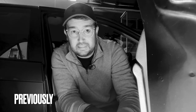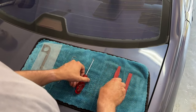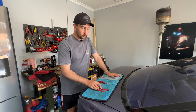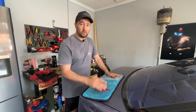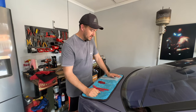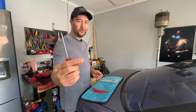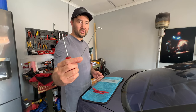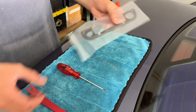For this project, this is exactly what you're going to need to get the job done: some trim removal tools, because you've got a little plastic gasket you have to get out of the way in order to get into the actual door and pop the handle out. You've also got this makeshift right-angle tool that I've made, because you're going to have to pull something out. That's the best thing for that, as well as a screwdriver to put it back again. And lastly, you'll need your new part.